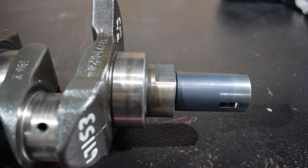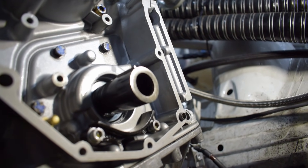So those are the three key elements to the diesel crank upgrade: the diameter of the snout on the front pulley, the second keyway, and the front bolt that houses everything. I hope this was helpful — quite a few people asked for this kind of information and I'm happy to share it. If there's anything else you'd like to know on this specific upgrade, please let me know in the comments. There are some nuances I've done with the pistons and specifically the cylinder head — a lot of engineering detail — so if you guys would like to see that, please let me know. Thanks for watching!